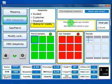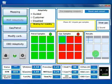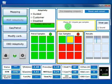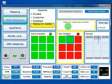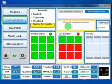Okay, as you see here, phase 2, we have to acquire gas samples, so now we switch to gas. As made before with petrol, we have to make the same way with gas. You can make the first row of squares here on idle. It is more simple, and it will take a very short time. Okay, and now we're going on the road.